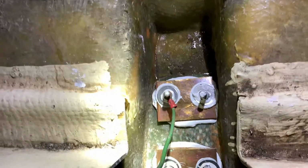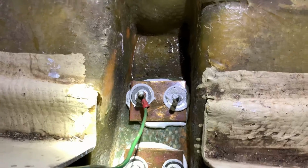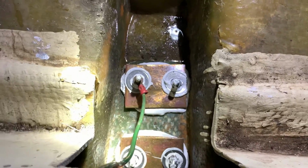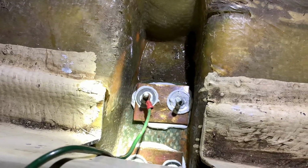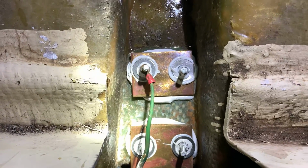And I'm sitting here in the locker, and this is Dennis. How's it going? And Dennis did a fabulous job getting all the stuff put together. So let me show you the shaft strut. We have the backing plates that were on the boat. We gooped them up with 4200 and put new bolts, so that should be nice and sealed. We got our grounding wire going in, but we got to get the nuts to finish it up. Other than that, it's looking good.